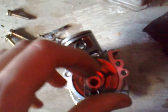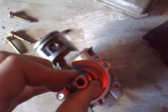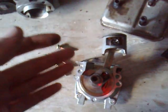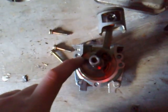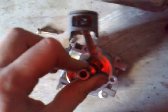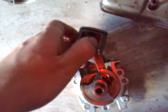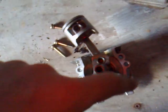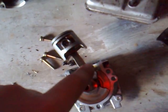And this is where all your motion happens. Basically, with a two-stroke, you don't put oil in the crankcase like a four-stroke. With a four-stroke, you fill up the whole crankcase with oil so it just sits in a bath. With two-strokes, you mix your oil and your fuel together. So when your piston is at its highest part of the stroke, the inlet will be about here and all this fuel will gush into your crankcase, which will lubricate your moving parts, bearings, and all that sort of stuff.